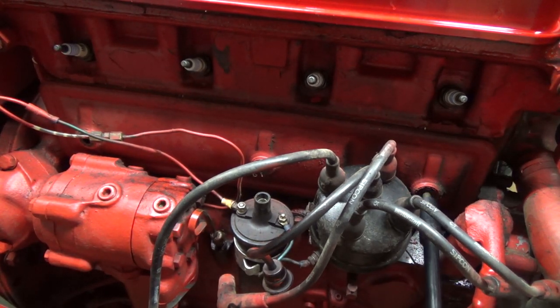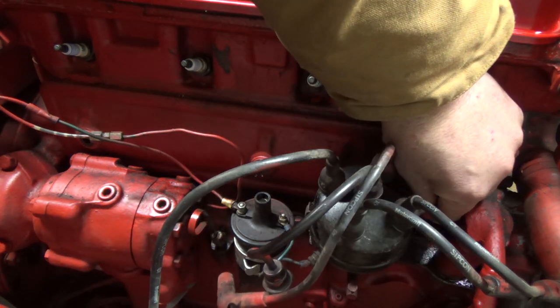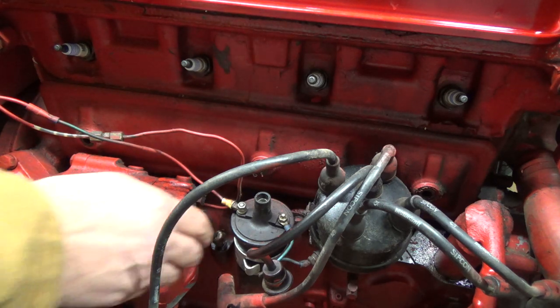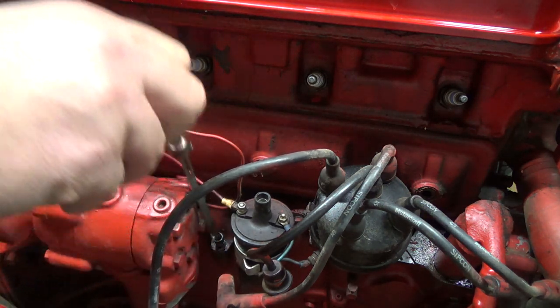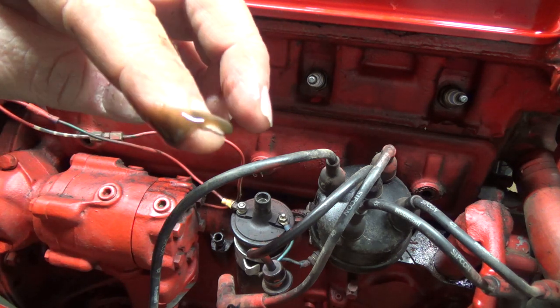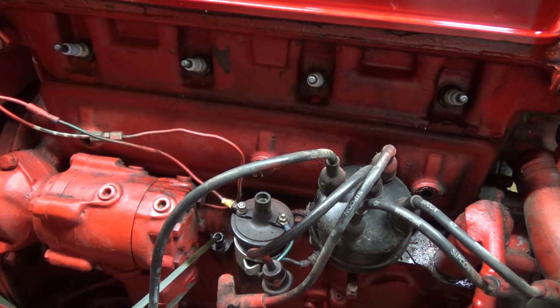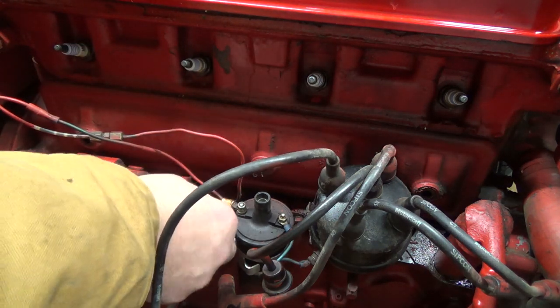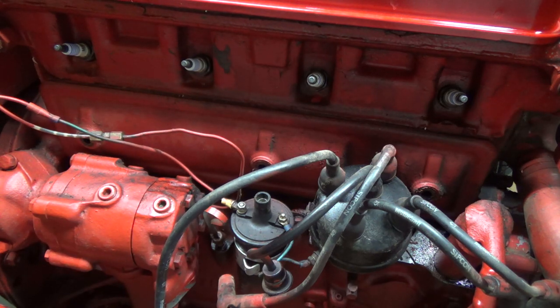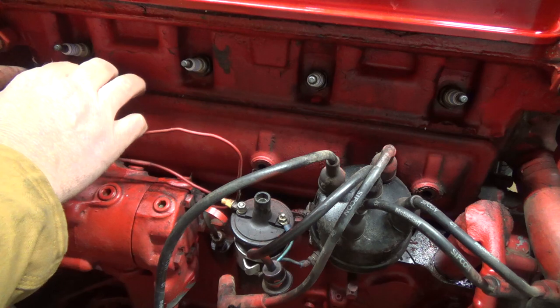Like, I don't know when this had an oil change last. I mean, it could be years. And hopefully they didn't just run it low on oil and then something else is making funny noises. Because it doesn't look the greatest. It's kind of slimy, like muddy looking. So that's why I really want to take off the... darn it, I didn't bring a towel with me. I really want to take off the oil pan when I drain the oil out, clean out the muck.